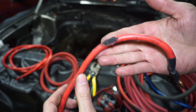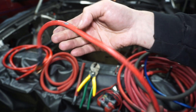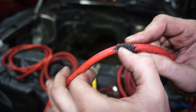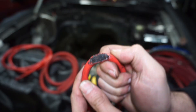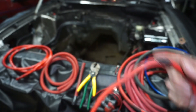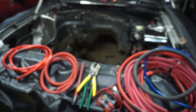This is the cable that actually came off this car, and it's actually a nice quality battery cable. It was rubbed on the exhaust so it was burnt — it didn't actually burn through completely and create an arc, which is good. But the quality of the casing is actually pretty important. You want a nice casing on it, or you need to run the wire really well and make sure it's protected — you can protect it with loom, the routing, fuses and breakers.